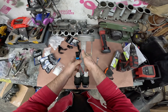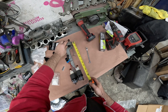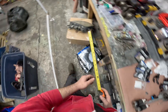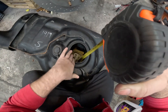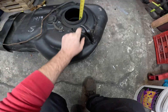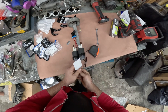I cut the bottom bracket off that the original fuel pump would mount to, drilled the hole. Now what I did is figure out the distance — this is the top of the fuel pump carrier that sits on the tank itself. I took a tape measure and measured — it's right around 13 inches to the bottom of the fuel pump. Then I went to my gas tank, went to the bottom of where the little splash reservoir is, and it's right around 13 and a half inches, so that gives me about a half an inch of clearance on the bottom of the fuel pumps with the filters installed.